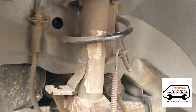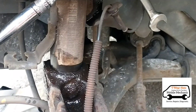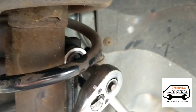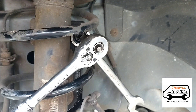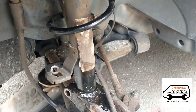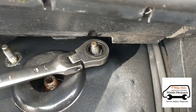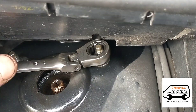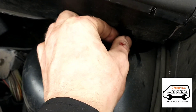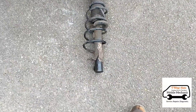With the wheel off, you can see the spring has come all the way down. We'll get this 15 millimeter bolt off, and we've put some WD-40 on and are getting the top bolt off for the anti-roll bar - that's a 15 millimeter with a six-millimeter hex key. On the strut, we give it a few taps of a hammer until it comes all the way down, push with the knee, pull it apart and open the top bolts. Unscrew the last bit, holding the bottom on a foot to catch it.